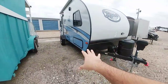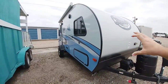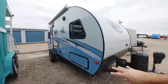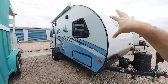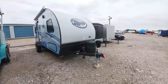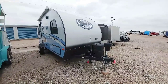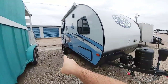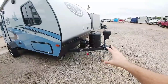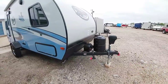If you have all sorts of accessories in the front storage compartment, a new thicker memory foam mattress inside, clothes and supplies up front, and the Durango loaded up with mountain bikes or accessories — all of that counts as tongue weight if it rests behind the rear wheels of the Durango and in front of the wheels on the trailer. That's why it's important to have a weight distribution hitch as well as a method of sway control, and to try to level out your ride as best as possible.